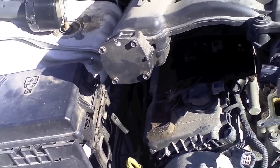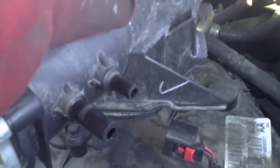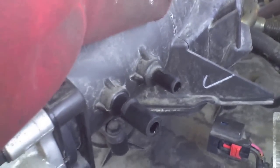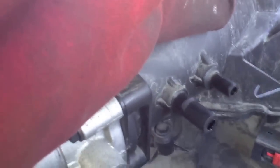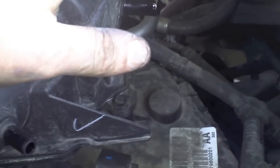I found two more hoses back here - one right here and then a metal hose that's a gas recirculation line that needs to go back into this flange right here. I need to make sure I get those two or else I'll have an exhaust leak, it'll throw a check engine light, and it won't pass inspection. All these hoses will throw a check engine light if you don't put them back in the right spot. These two hoses are different sizes so it shouldn't be a problem putting them in the right place.